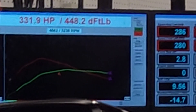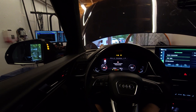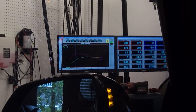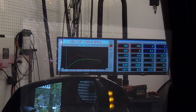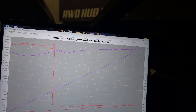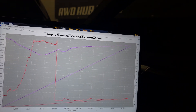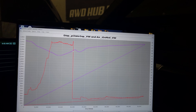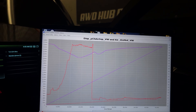The engine needed time to cool after the install, so we didn't see any gain on that pull. Let's do another one and see if this pipe is worth it. Here are the intake air temperatures with the turbo intake pipe — we're at 39°C. It's colder outside by three degrees, but this is 39°C as well. We did not change any intake air temperatures, so it's not bringing in colder air. What's the turbo intake supposed to do? Bring in more air, and probably colder air because you're moving more air past it — but we're not seeing anything of the sort.